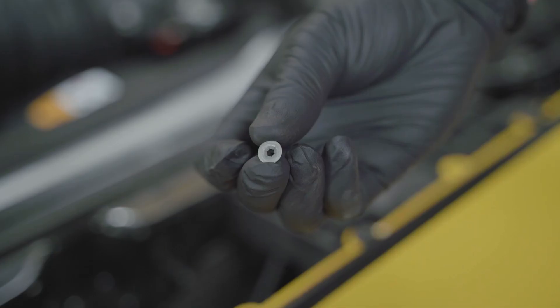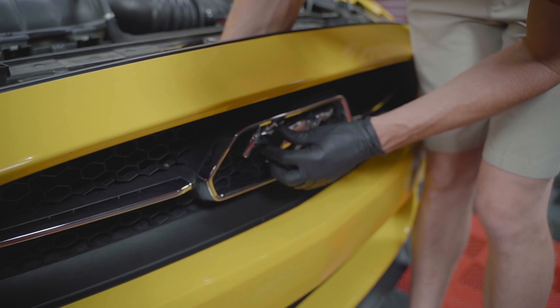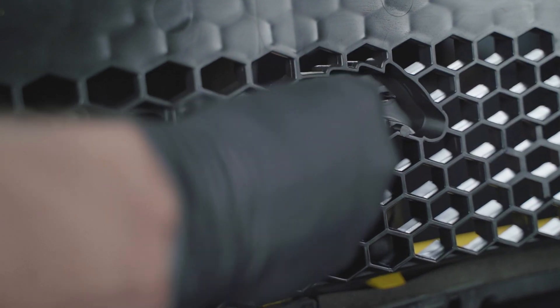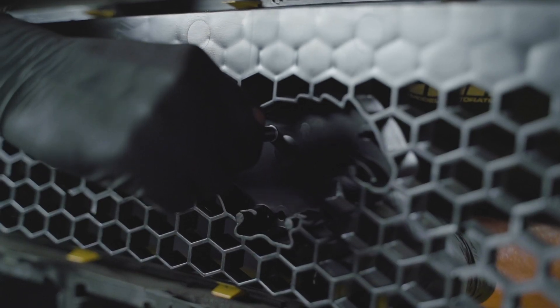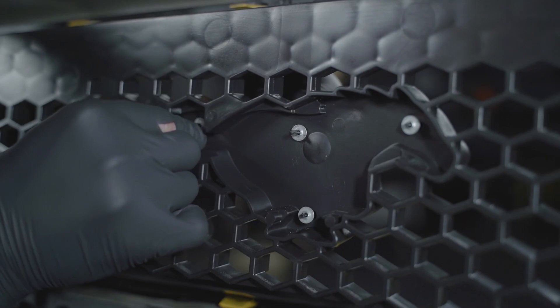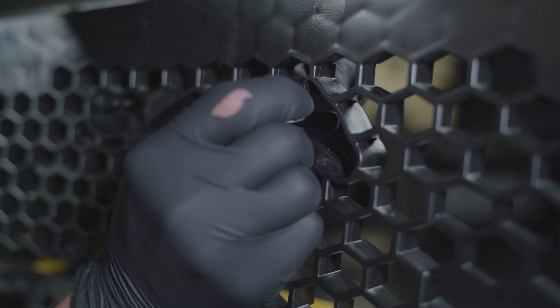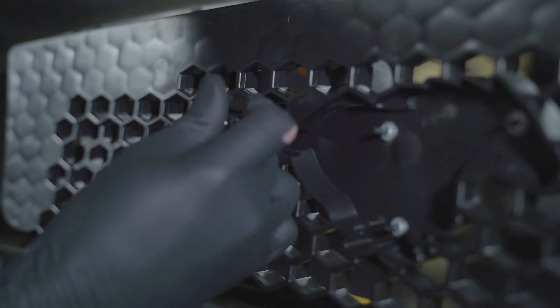Position the new emblem into place. Reach inside of the opening with one of the retainers and locate any of the four tabs. Position the retainer over the tab and push it on just enough so that it remains in place. Use a suitable socket to fully seat the retainer. Be extremely careful when doing this, as the tabs on the emblem can easily break. Make sure the socket is nice and straight whenever you fully seat the retainer. Repeat this for the other retainers.